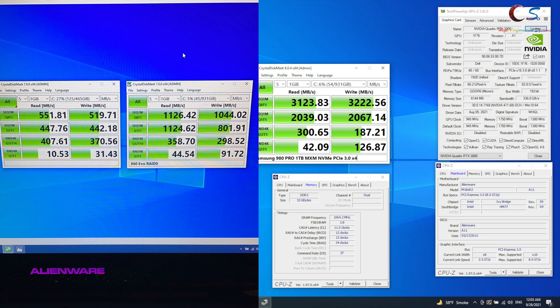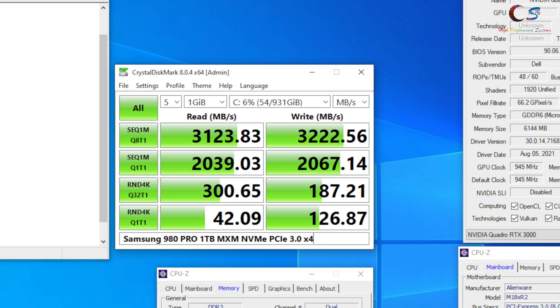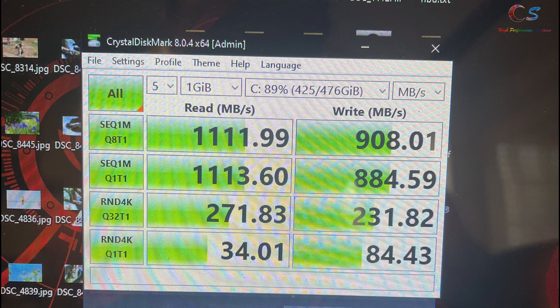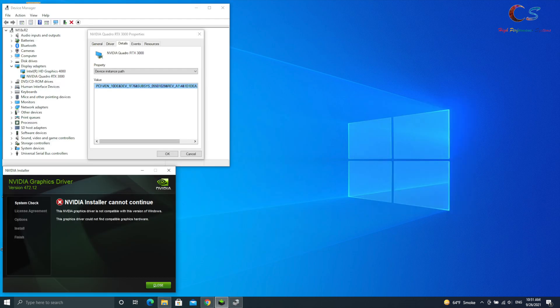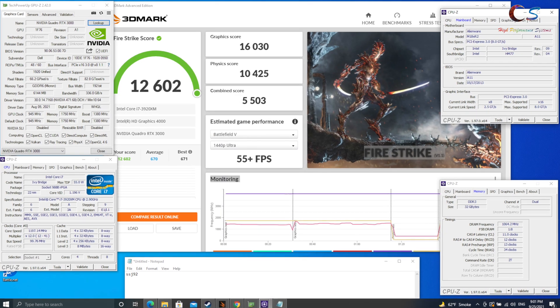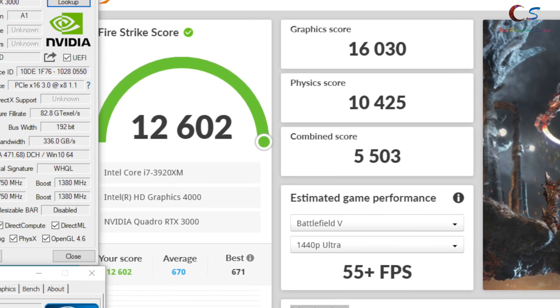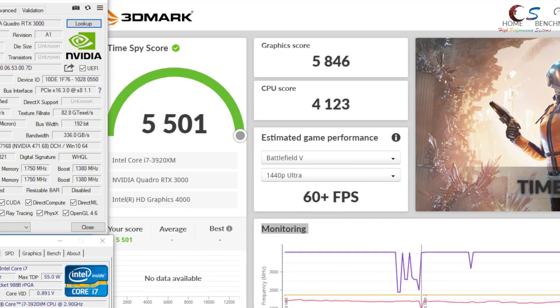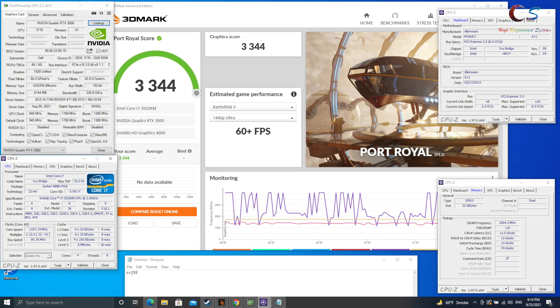Let's take a look at some SSD benchmarks. On the left side here, we have an 860 EVO with RAID 0 and single. The NVMe drive gets full PCIe 3.0 x4 speeds — here's a screenshot of my previous RAID 0 setup and a bonus benchmark. Moving on to the GPU: you can't install the drivers normally. You have to modify the INF file and add the hardware ID, which isn't too hard and takes a few minutes. Once it's done, the control panel recognizes the GPU perfectly fine. In Firestrike, it got about 16,000 graphics score, which is pretty good — for 1080p this will work really well. The Timespy score was 5846 for graphics, which should provide great performance at 1080p. And since this is a ray-tracing GPU, here is a Port Royal score.